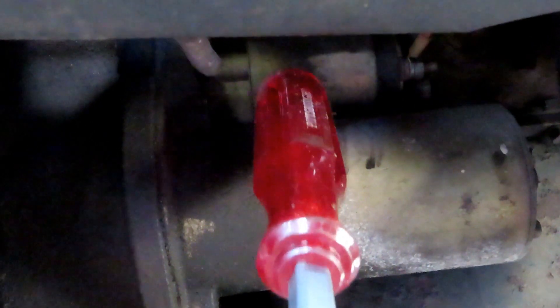Get up from under there before you start it. So don't do what I'm about to do. Here we go. There's our starter. Let me position our screwdriver. First thing we're going to do is verify that it doesn't start — try it two times. Okay, there it go. Now you can either hit the solenoid. Try it. Okay, stop. Then you're going to hit the starter — hit the big, bulky part. That's the part that freezes up. Okay, try it.